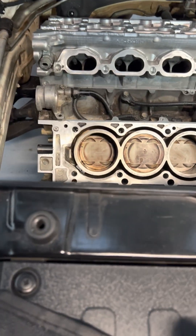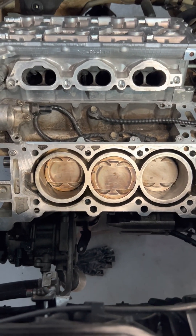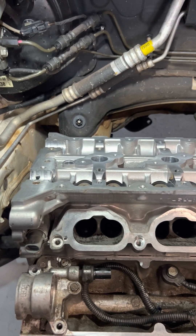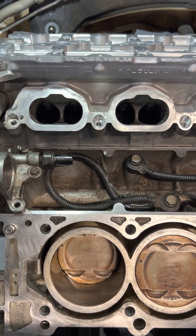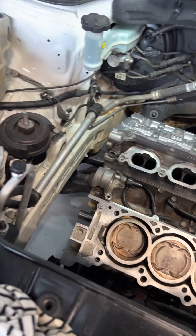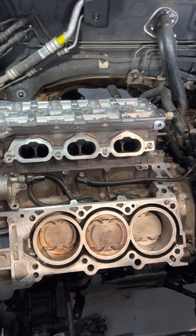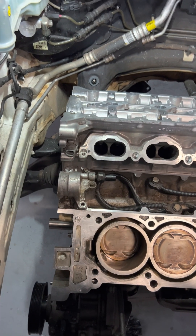Next step is the bank 2 cylinder head, which is the left side of the engine. When assembling the cylinder head, the cylinder head bolt must be a new one and must be cleaned properly and dry. Make sure that you don't put anything on the cylinder head — no lubricant, as specified in the manufacturer's manual.